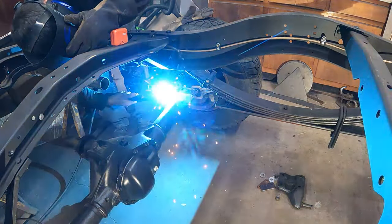Bam. I hit the pieces with the grinder, threw a little black paint on them, and we're ready to roll. I'm going to put a little bit of grease on the bottom of the spring, actually on top of the pad. I'm going to make a plate — there's a plate that goes on top of these that was all rusty from the original. If you just put the U-bolts on with no pad on top, they push on the corners of the spring into the thing there. These are meant to sit with a spacer on them. I also need to get longer U-bolts because picking it up in the front there, the U-bolt was going to be too short.